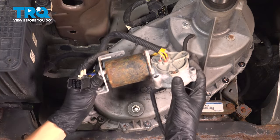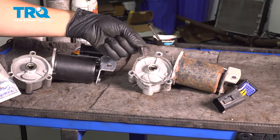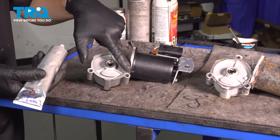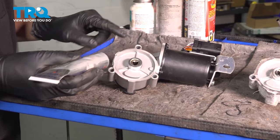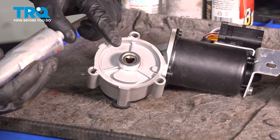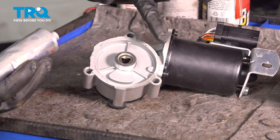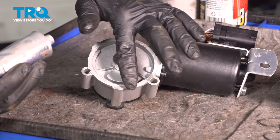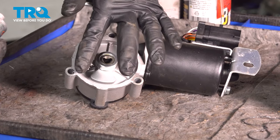On the old transfer case motor, there was no gasket on here but there was some RTV, as you can see. So I'm going to put some on the new one — a very thin layer, just so it can seal up around where the shaft of the motor mounts on. This is way too much, so I'm going to spread it with my glove. That way it makes a nice watertight seal. If you don't do this, most likely corrosion will build up there, seize up the shaft, and moisture might even get inside the motor — you'll have some issues.